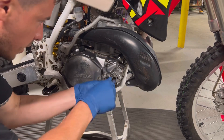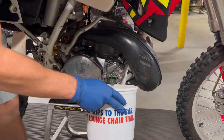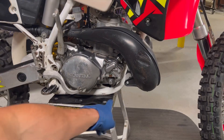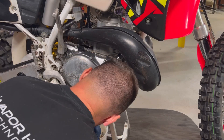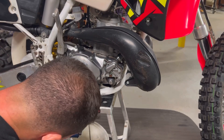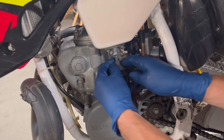First thing I'm going to do is drain the coolant — it's this bolt right here, the rusted one with a copper washer. I'll pop the cap off the top and it comes out a lot faster. Next I'll drain the transmission fluid, and when I cracked it loose it was actually pretty dirty — very dark, kind of gray. Got that drained.